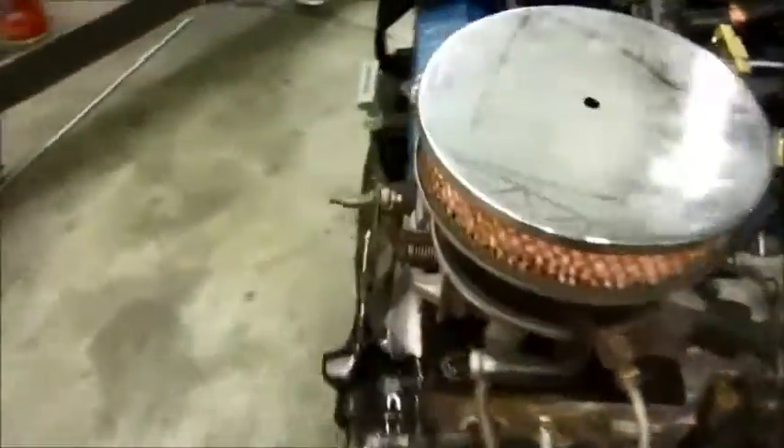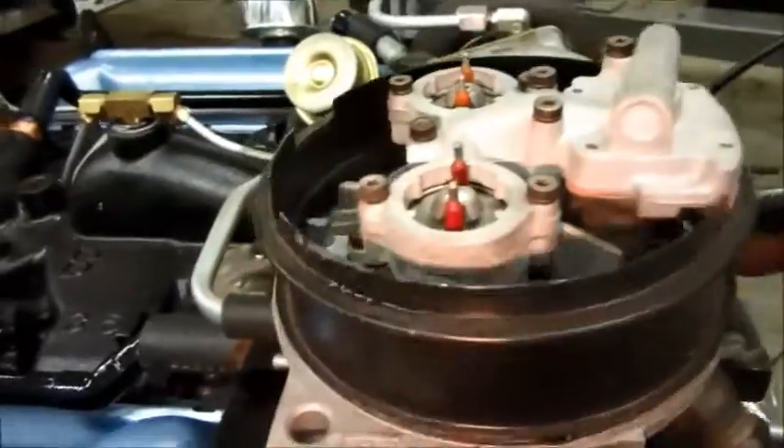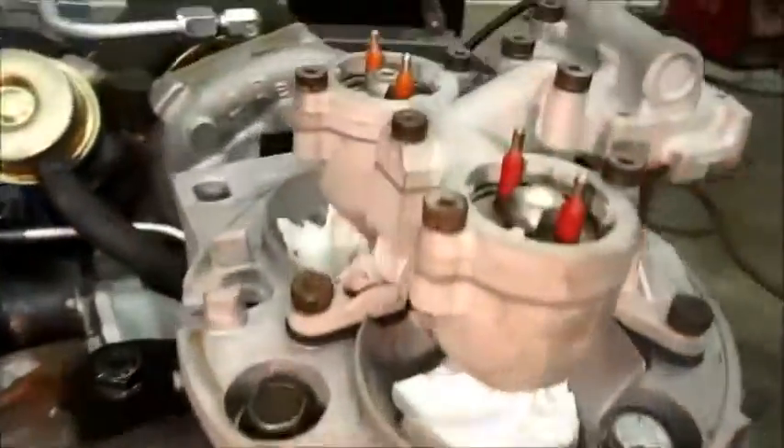All the tube lines that are going to be black are painted black. I got the transmission dipstick put in place. Also got the throttle body rebuilt — as you may remember from earlier it didn't have any injectors, so I got all the injectors in there along with a new fuel regulator diaphragm and all that kind of stuff.